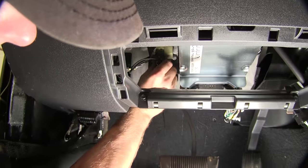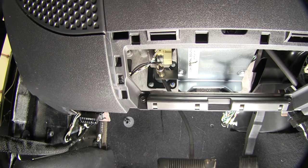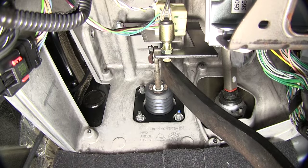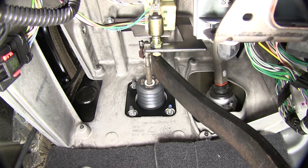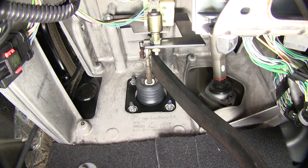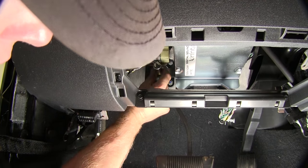Now we've got it loosely installed here. It definitely helps to have an extra hand or foot push on the brake pedal while you put the star washer and nut on the other side of the plunger for the switch. Basically, you just want to look underneath here and adjust your switch in or out as needed to make sure it's fully depressed when the brake pedal is not being pushed. When you push the pedal down, you can see how the white plunger is exposed and that will activate the switch. Also, you want to double check to make sure that the switch is not pushing on the brake pedal by itself and turning on the rear brake lights when it doesn't need to.